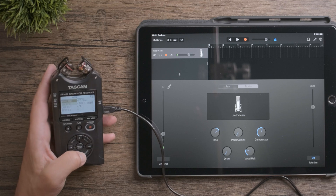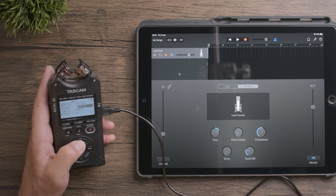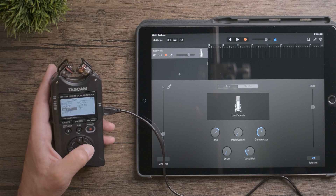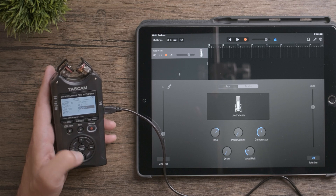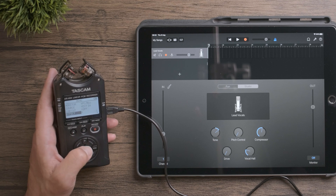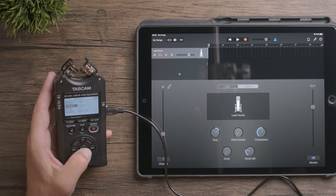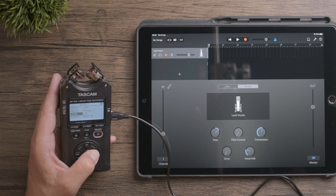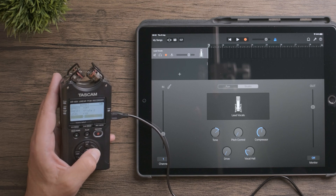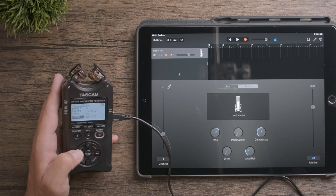To select internal or external microphones, hit the menu button and select source — you can choose between internal stereo, internal mono, or external in. While we're here, there's a low-cut filter at either 40, 80, 120, or 220 hertz. We've also got some reverb effects: at the top there's a master on/off, a selection of rooms, halls, plates, studios, the level of the effect itself, and whether the effect is applied to the internal or the external microphone. I'll leave effects off.